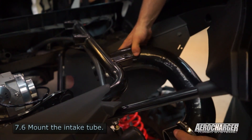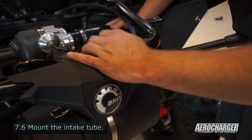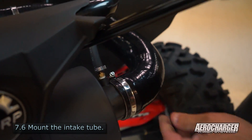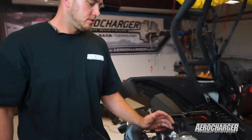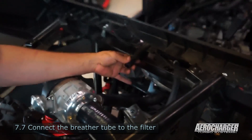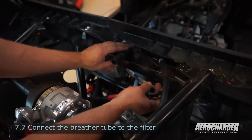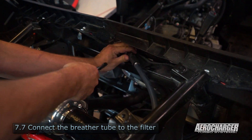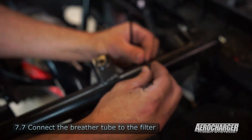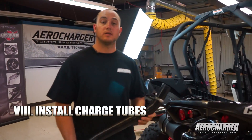Now we're going to mount up your intake tube. The big end goes on the end of your Donaldson air filter; the smaller end goes on the AeroCharger intake side. Now that you've got that hooked up, we're going to hook up our vent tube — this goes to the PCV tube that we rerouted earlier from the front of the vehicle to the rear, because our intake is on the rear and the stock is on the front. Hook it up, slide your clamp down, and then put a couple zip ties on the hose here to this bracket in the subframe.